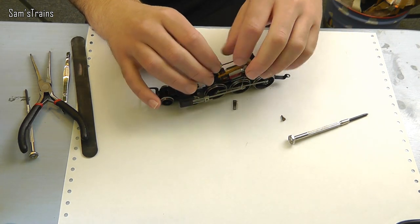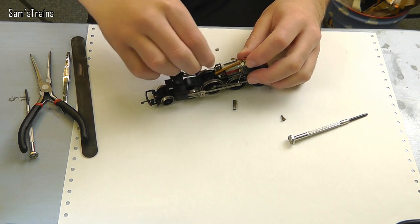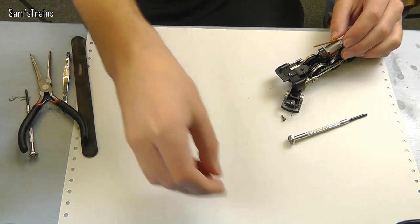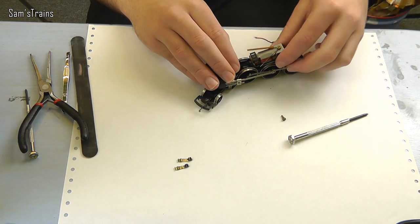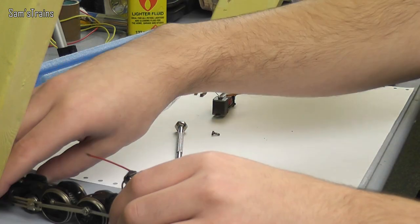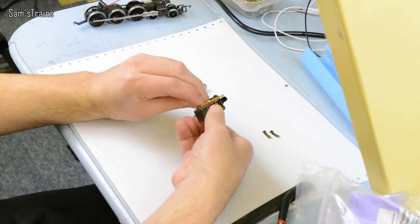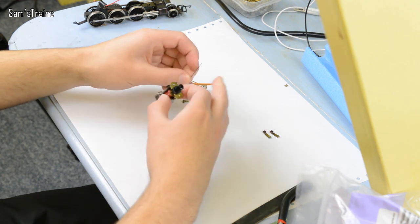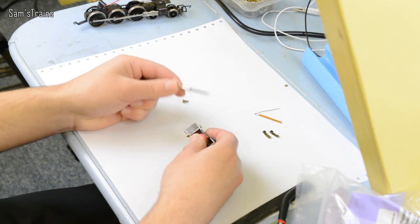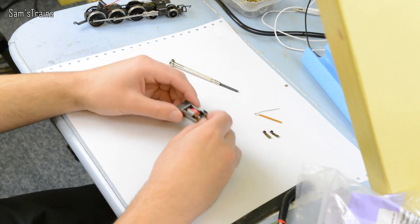I've got to see what we can do about the soldering. Let's get these brushes out — there we go. Obviously you've got to look after those. There's a bit of debris from the contact plate — never mind. There's the motor; I'll put the chassis to one side for a moment. The motor really doesn't look all that bad to be honest. Let's take this spring off and look after that as well. Now let's test the magnet — the magnet's really good. I will re-magnetize it anyway just in case, but it's pretty good.